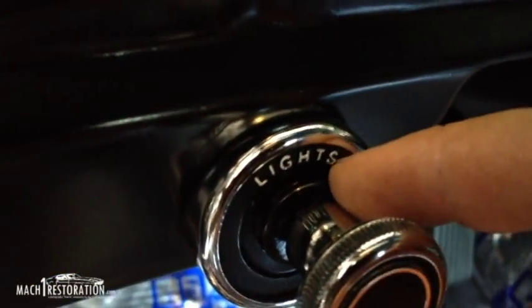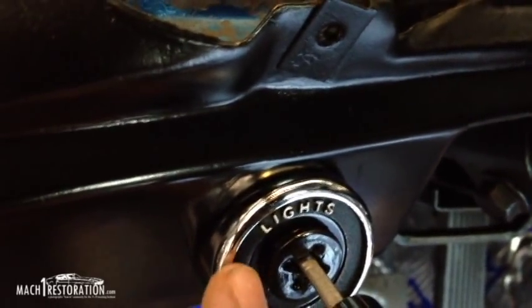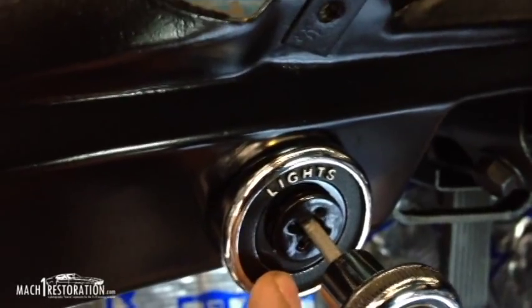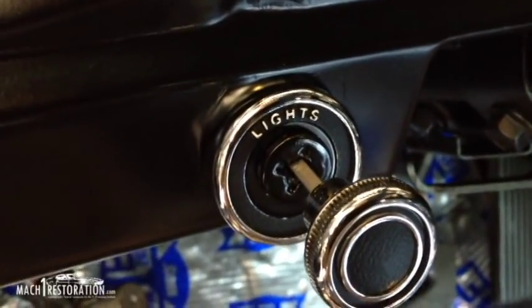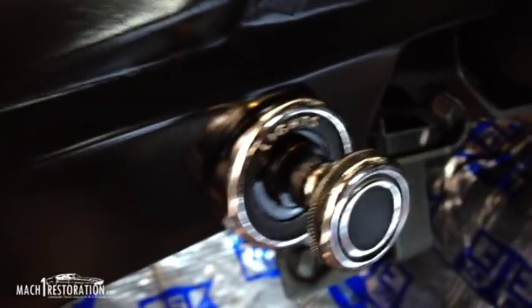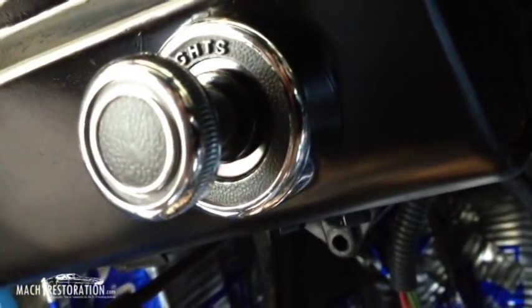The second problem you're going to run into is you're going to try to put your bezel retaining nut — this black piece sticking out here that looks like a Phillips head — you're going to try to put that on there, and it's not going to tighten into the bezel because the opening is too wide. So you're going to have to find some sort of washer or spacer to put in the bezel to hold the retaining cap or retaining cup, and still be able to rest against the bezel nut. That is a next-to-impossible feat if you start digging around at the home improvement stores. There are actually a couple of posts online about guys trying to find the correct washer that fits in there without any space around it — which mine doesn't — and still fits the bezel retaining nut.